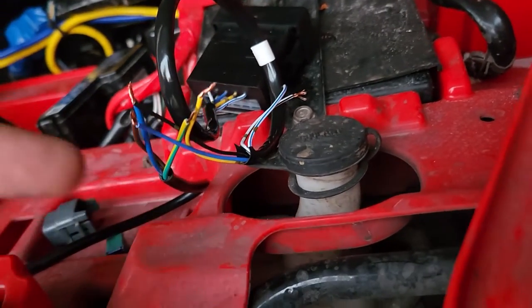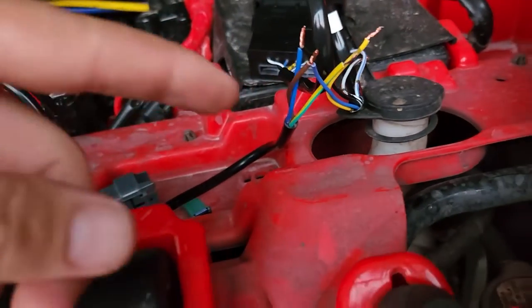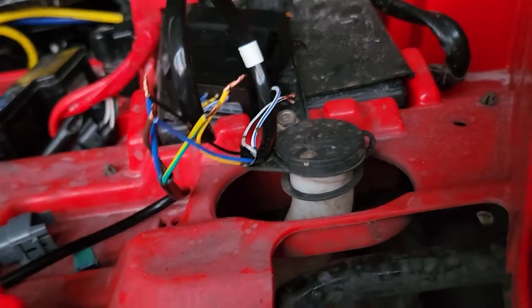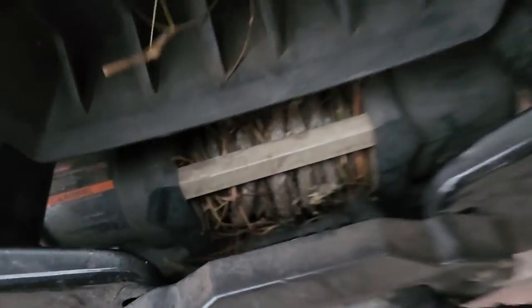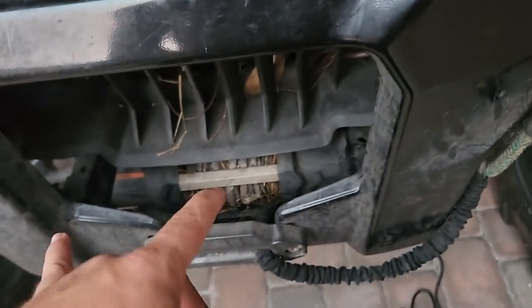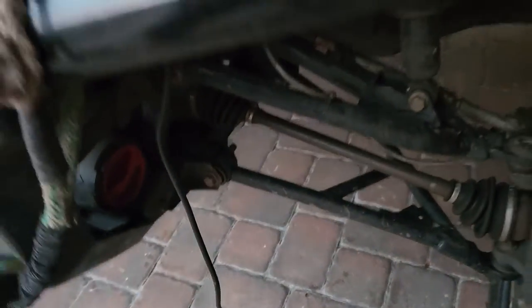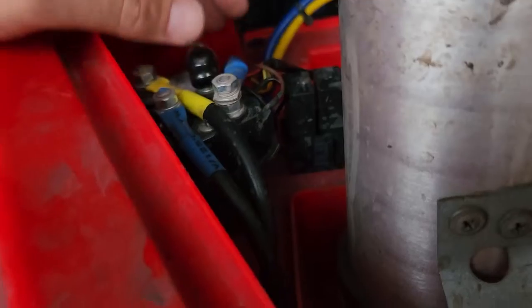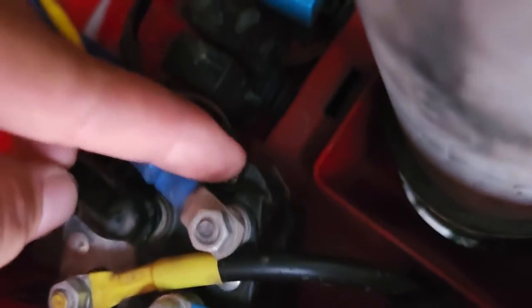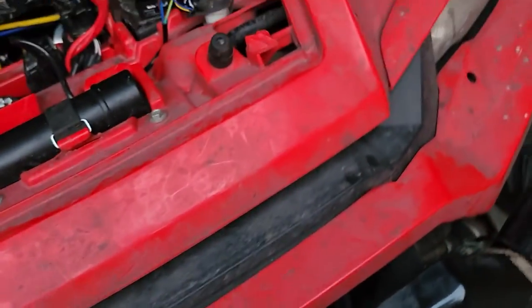On my winch, in was yellow to yellow, brown to blue, and black to blue. Your winch might be different depending on the brand — this is a Walmart 'Tough' winch, about a hundred dollar winch with synthetic rope, working great. The free spool isn't the best and gets stuck sometimes; that's why you get a Warn for good free spool. All you need to make it work is give power to the solenoid on either pin and the winch will go in the opposite direction. Pretty simple.